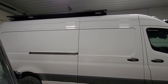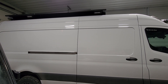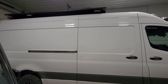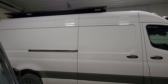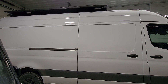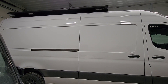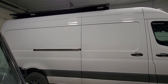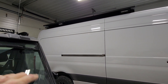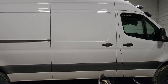Hi, this is Jason with ECG Solar. I wanted to circle back on the issue I was having with an aftermarket relay for my inside cargo lights. I added some aftermarket cargo lights using the OEM cargo lights as a switch leg and was getting some buzzing through the relay. This relay controls the inside lights and the two lights on each side of the truck to give ambient light for the sides. I finally got that resolved and just want to show you the results.